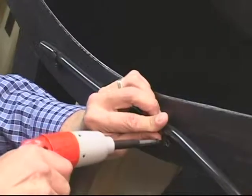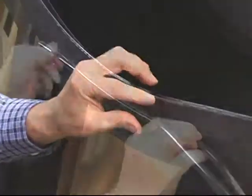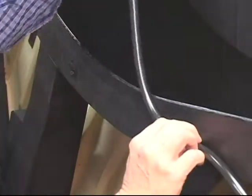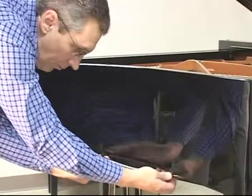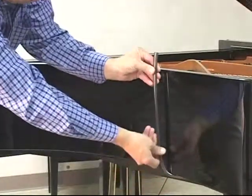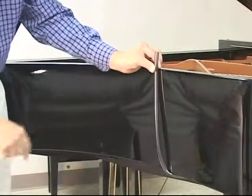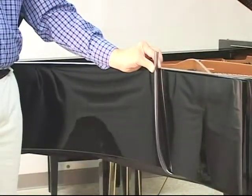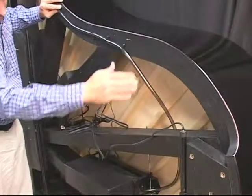the tube so it can be removed when the humidifier needs to be filled. Use 3/4-inch screws to anchor the half clamps. The amount of tubing available to be removed should be sufficient to reach the top of the rim of the piano. The fill point must be higher than the top of the humidifier tank for water to flow into the tank. Two standard clamps are used to hold the watering tube between the rim and the humidifier.